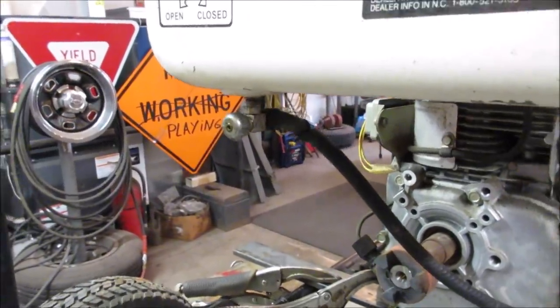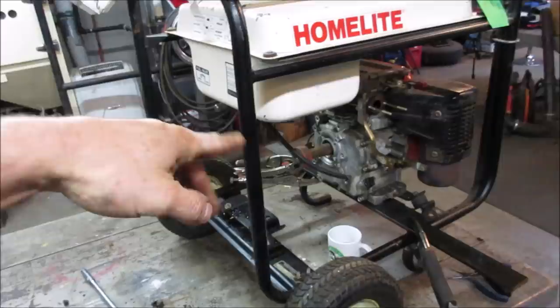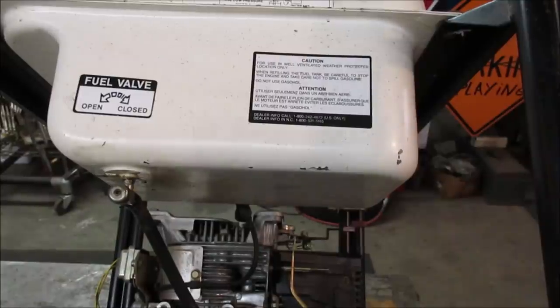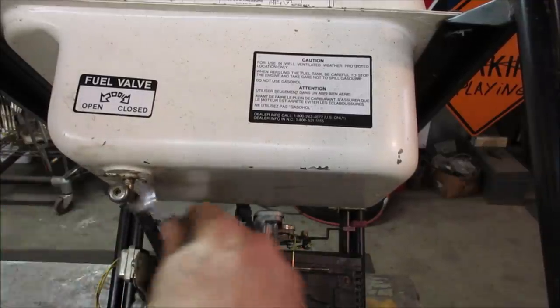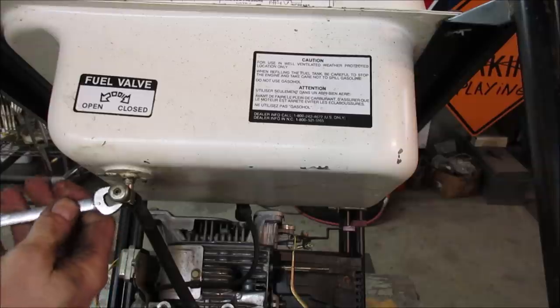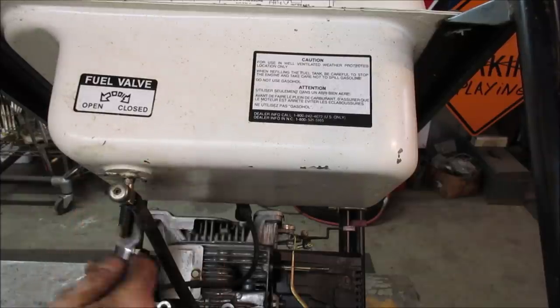All right, I'm gonna go unbolt that. We're gonna probably tilt it forward so the gas goes to the front of the tank, and see if we can undo that and see what's going on inside. Generally there's packing that goes around it on this gland nut that I'm taking off, and you can kind of tighten down on that and it'll crush that packing around the shaft.